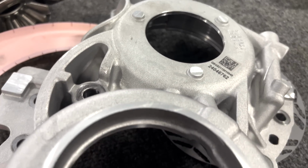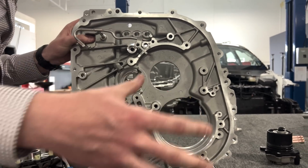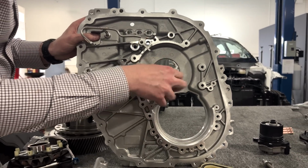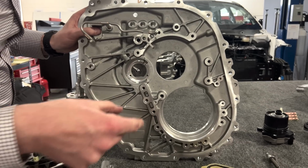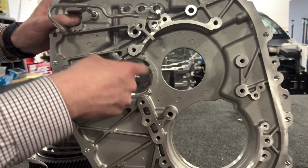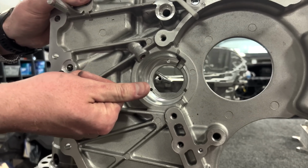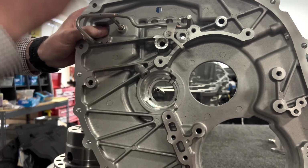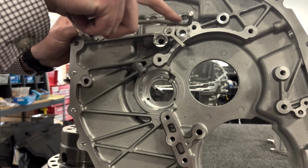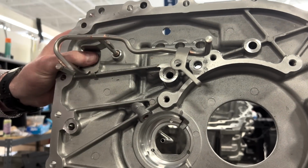So if you kind of picture this, here's the differential assembly coming through here, and then it'll be encased with this gearbox cover itself, and then the lay shaft gear here. So the rotor is directly concentrically in line with here. So we have a single directed oil squirter right down the rotor shaft itself to lubricate it, dedicated to this. And then this is lubricating the top of the stator assembly, which is fixed inside of the housing here.